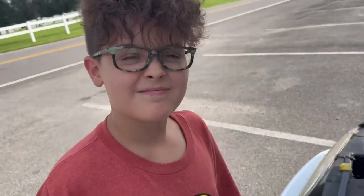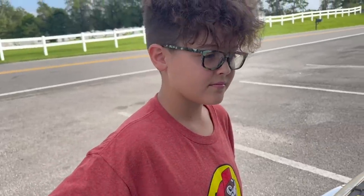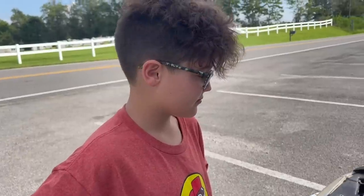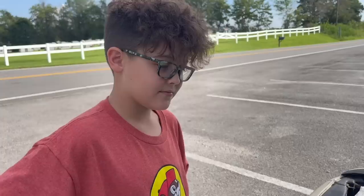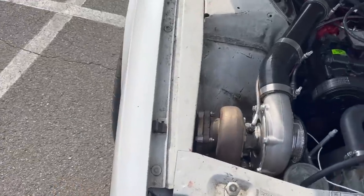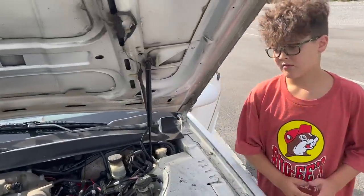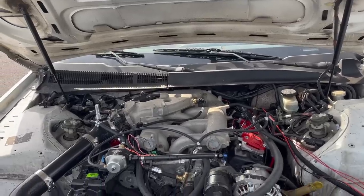It's unfortunate. It puts you back in your seat. It does. We're definitely going to have to go down on wastegate spring to get less boost out of this because it's got all the boost right now. Ralphie said it hit 15 pounds of boost, so less than that would be good right now. That's sad. Unless we switch fuels. I have no way to turn the boost down, though, so we're going to have to go with a weaker spring. We'll have to go through our springs and change it out, but we'll still play with it here. Let's take it for a ride.